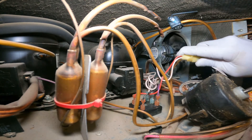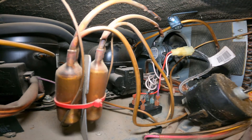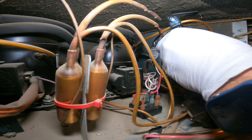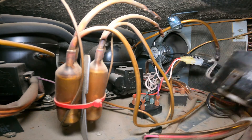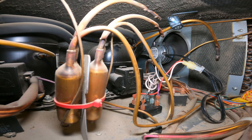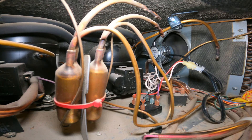The old fan is not running at all — it's shorted. You can see it's completely quiet, so we're going to remove it. With the new fan installed, it's running great. So both parts are shorted: the condenser fan motor and the relay both had to be replaced. In 15 years I've never replaced the relay before, but apparently they both failed together. In the next video I'll show how to replace the condenser fan motor.